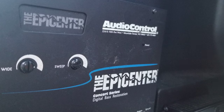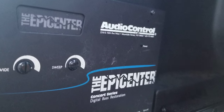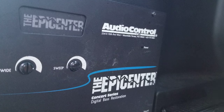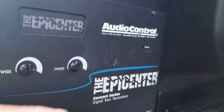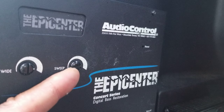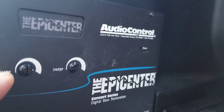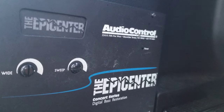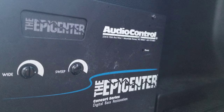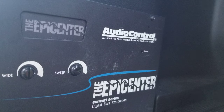You can see I have mine at the midpoint, and the reason is because my enclosure is tuned to 32 Hz. So I have the frequency set at the midpoint but I have the width set as wide as possible. So even though I'm restoring frequencies at 37–39 Hz, because the width is set as wide as possible, it's dipping all the way down to 32 Hz — my port would dip down to 28 Hz — and it's also going up from 38 to 48 Hz.